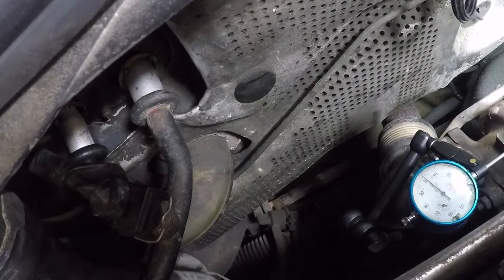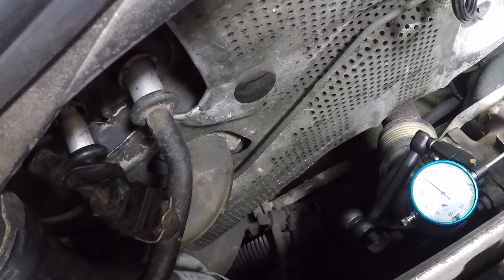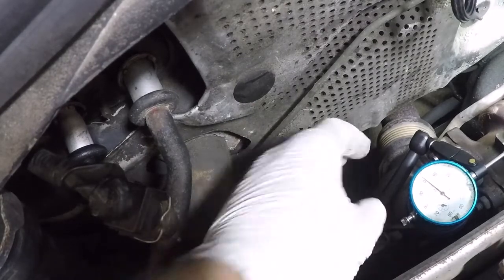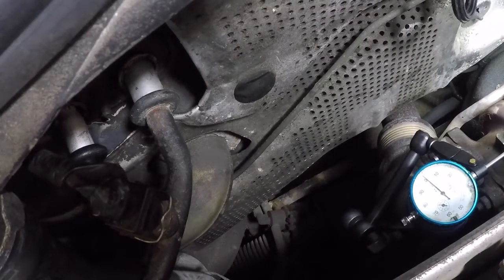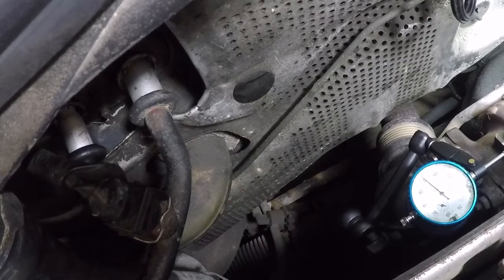How I'm going to do that is I'm going to introduce a MightyVac little radiator pressure tester. What's nice about it, it's got a handle so I can control the pressure very well. Is it super accurate? No, I'm not going to launch a space shuttle with the thing. However, it's going to allow me to control the pressure very straightforward so everybody can see it. I'm going to zero that out and apply pressure to detect any movement on that wastegate, because if it moves, it cracks a little seal inside. So pressure starts bypassing out of the exhaust.